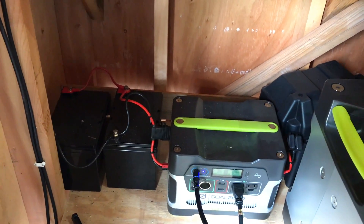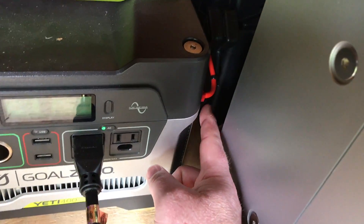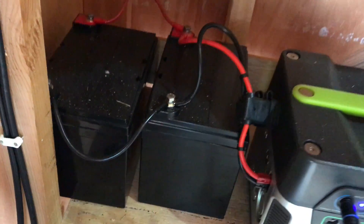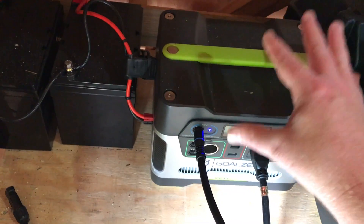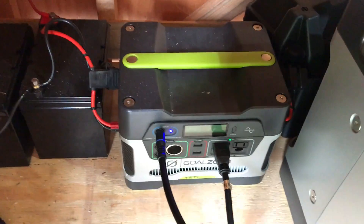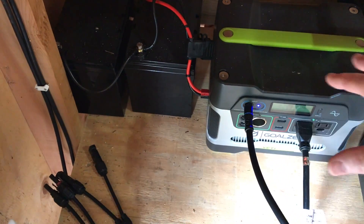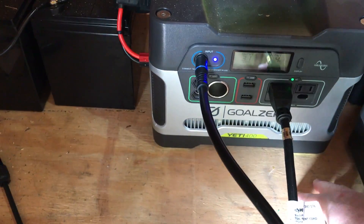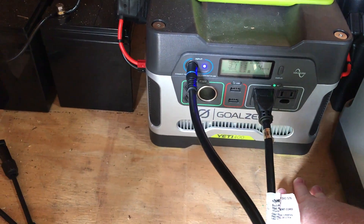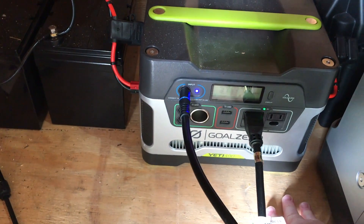As far as the connections: I have an Anderson Power Port here linking in two batteries, and another Anderson Power Port linking in two more batteries. Basically this becomes one big 2,000-watt battery. I'm not increasing maximum output power — I'm just making the battery bigger. It still has the same solar charge controller, and I can only put in around 120 watts.